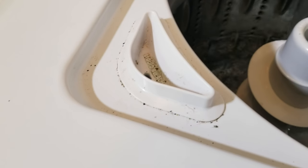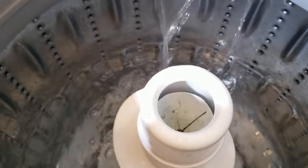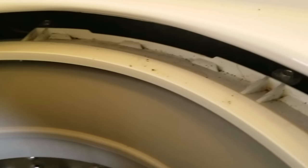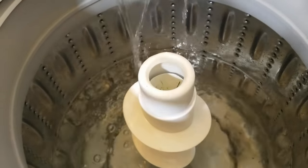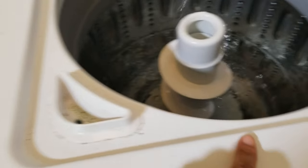I'm going to show you the extra parts we're going to clean. A lot of dust, dirt, and dog hair just gets trapped up in here, and a lot of sand. The fabric softener dispenser — we're going to take this apart and clean it out. Once this fills up, we're going to use the water from this to clean all these extra parts. A lot of people who clean their top-loading washing machines forget to clean all this — they focus more on the drum. But we're going to get this baby sparkling clean, almost new. I'm going to let this run a few more minutes, let it agitate three or four times, stop it, and let it sit for about 40 minutes. While it's sitting, that's when we're going to get started on cleaning the gunk.